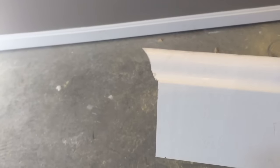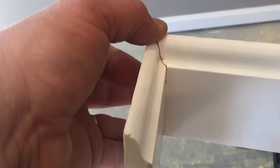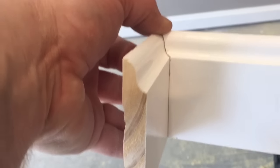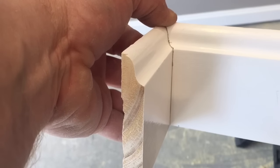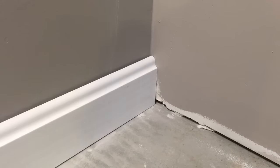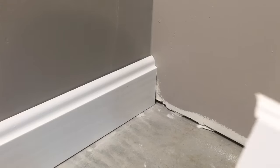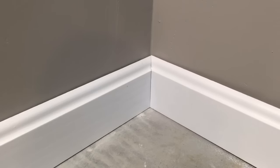Take a look at the contour right here and how well it fits together — that's what it's going to look like on the wall once we get it together, a lot better than before. This works great for bare wood if you're going to stain it; you can also caulk so it's not that critical. I take my flat end, push it all the way up against the wall, take my coped end of baseboard and put it right up against it and push it tight. You can see how well it lines up — and that's how you cut an inside corner of a baseboard. I'm How-to Bob, thanks for watching.